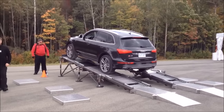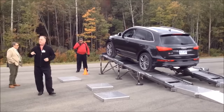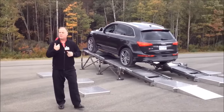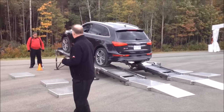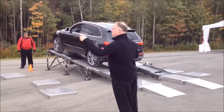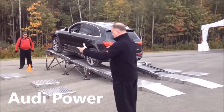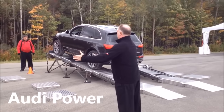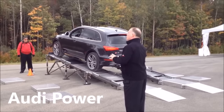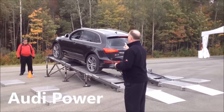One tire's got grip. We've got a mechanical system that flushes out what's happening north-south, sends torque to the front. The front diff is open. We can get a little bit of wheel spin. We mitigate it by using EDL, the ABS traction control, and it sends the torque to the one tire that had not great, but okay traction, and it walked the vehicle up.